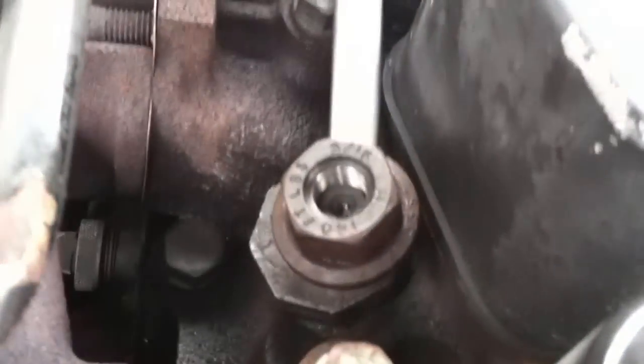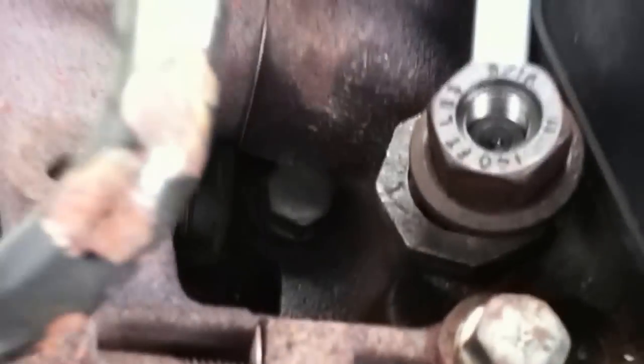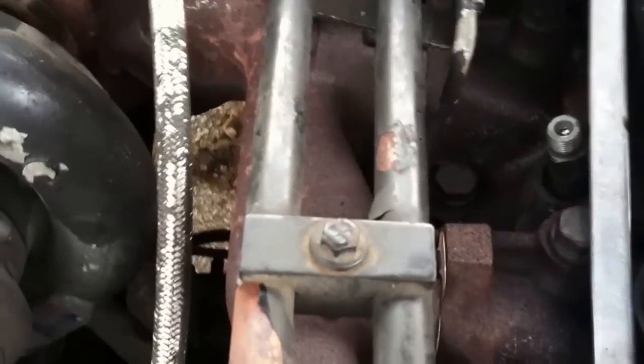So it's pretty simple. You probably figured it out already. I had to try a couple of different wrenches to get one that had the proper thickness that acted as a spacer just so. You want to make sure that you got plenty of threads left to do your pulling, but also plenty of threads engaged so you don't strip anything out. Anyway, there you go. And get a 15/16 inch wrench on here and just very slowly twist away, and